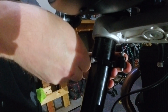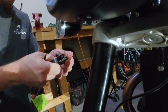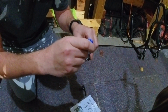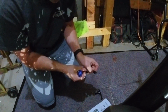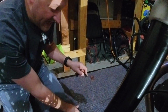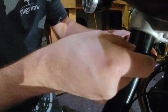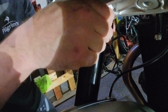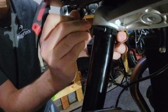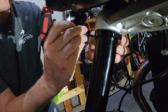Okay. So, but I'm gonna get my blue thread locker. Well, if we had to take it off anyway, then I might as well put the thread locker on the screws. So there's one screw. So you just put a little bit of this, that way it doesn't vibrate and fall off. Oh, I thought it was so it wasn't squeaky when you put it in. No, thread locker will keep the screws from coming out on their own. It makes the screws kind of sticky in there. So it's like a really weak glue. Yeah, and like you said, if you use red, it's really strong. Yeah, exactly. Red is too much. Red is for something that's really critical and you probably never want to take off. Yeah, exactly. Like a brake. No, actually brake calipers, surprisingly, you don't use it. You use grease because you don't want them to seize, because that is something you do take off frequently. So contrary to what you would think.